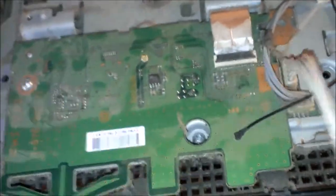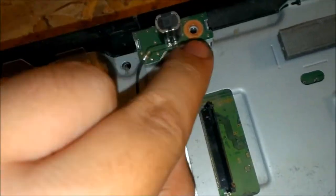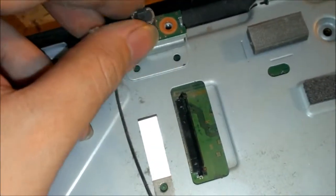And once you got the connections off here, the 2 screws, or the 3 screws out of the front, 2 screws in the back, and this electrical plug, push down on that tab, and the power supply will come right up off in there. And then you got this here, which is only held on what looks to be, this right here, the little optical sensor hooks in right here. There's another screw. Once you remove the DVD drive, you'll be able to see it, and it just pops right up off in there. You lay that to the side with all your other screws. And the power supply, lift it straight up. Don't cock it in any way, because these 2 little probes are right here, or prongs or whatever.